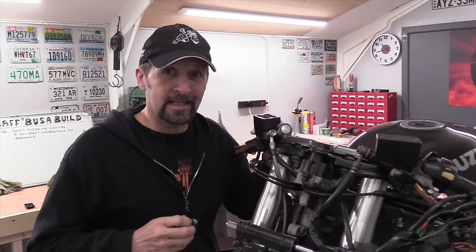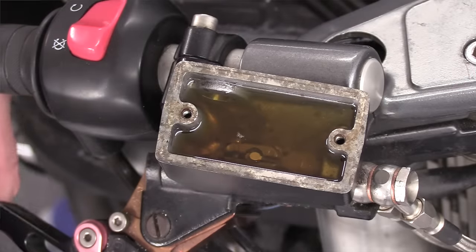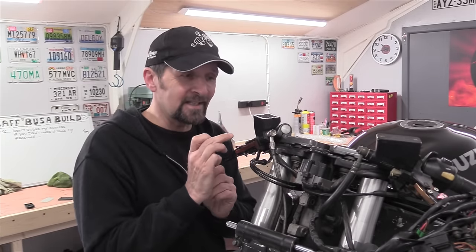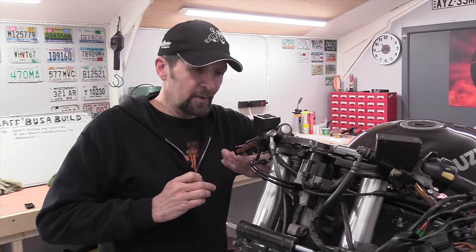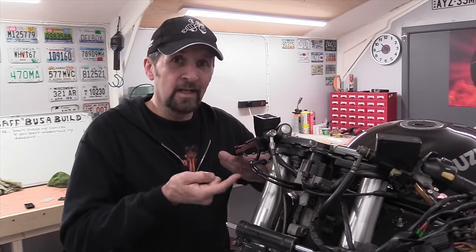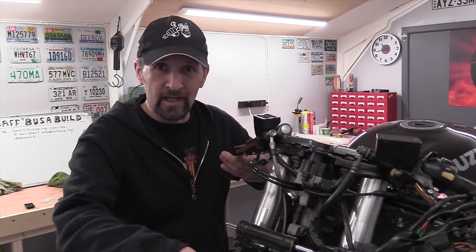Hose off at the bottom, dangling over a jug to catch the drips. Now we're just going to use the lever — wiggle it in and out gently and you'll see little bubbles coming up into the reservoir fluid. This little piston inside the master cylinder is tiny and it only moves tiny amounts, so it's only feeding tiny amounts of fluid down at a time. You need some patience — just wiggle that lever backwards and forwards. You're not doing a full pump; little wiggles just to coax the fluid down. Gradually, slowly but surely, as the bubbles come up, fluid is going down.